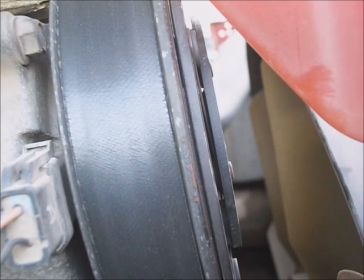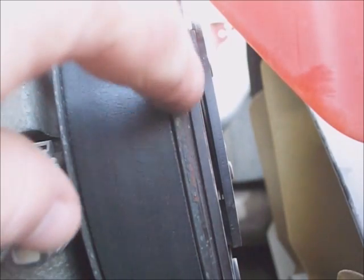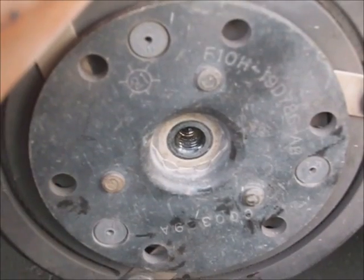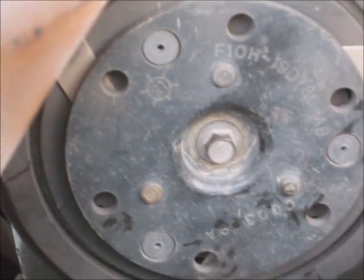Back in business for a while. As long as it's not touching while it's running and you don't hear any scraping noise — if it's too close, you'll either have to grind the existing washer down to half thickness or replace the whole clutch assembly. That bolt tightens down to 123 inch-pounds to keep it in place. I'm going to engage the compressor clutch and tighten it down, let the motor hold it — okay, it's tight.